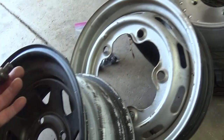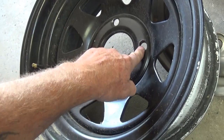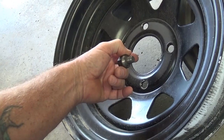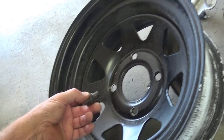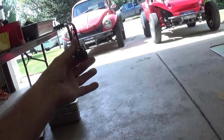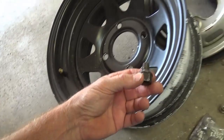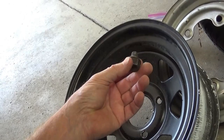Then you have the newer style that took a larger wheel nut — it was a 14 millimeter — and your short one is a smaller diameter. The wheels are a little bit heavier and fit on most balancers a little bit easier. That was a change they made when they went from the wide-5 to the 4-lug. This is an off-road wheel for the Baja — it's a '69. This rim here is 8 inch and it's probably going to receive my new tire, but this lug nut will just flop in the hole — it won't work.